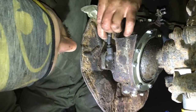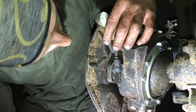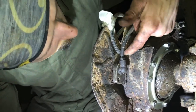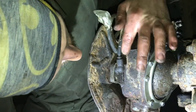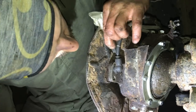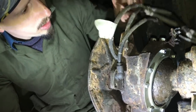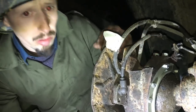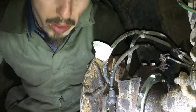Kieran's just refitted the ABS sensor. Now we're trying to put the two vacuum hoses back on, which have been a bit of a pain — mainly just this bottom one where access is really quite awkward. It's most of the way on there — might just get the pliers on to help seat it right to the base. The other one is nice and easy, just sits on top.